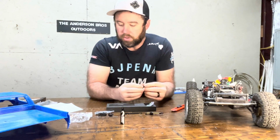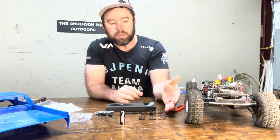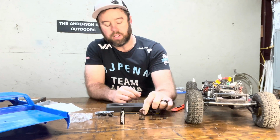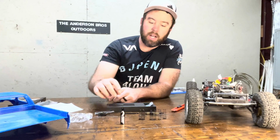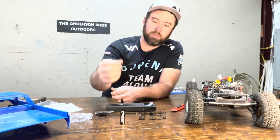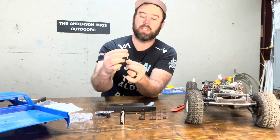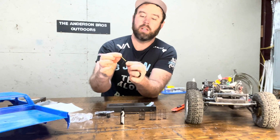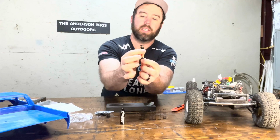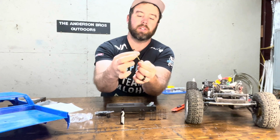There is a mixture of them. You can see we have, I think, light, medium, and heavy. Light here on your right, these are light springs. It comes with super light springs in the shock itself. Those are for the top, where it keeps the piston full stroke. And then you have the same springs for the bottom. So these would be this right here. You can see, again, we have more stroke out of it, but this spring here keeps it from bottoming the shock out.